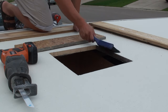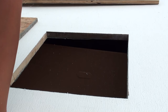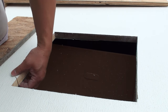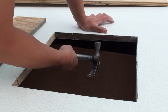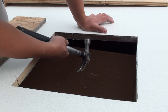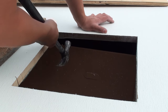Now remember, this is fiberglass, so you can actually get fiberglass slivers, so err on the cautious side. This is what the hole looks like once we've completed the cut as cleanly as we can. I made a minor error by cutting just a bit too far, but that's probably not going to affect structural integrity — it's just a tiny wedge. The weight is being supported by the steel bracing built in from the factory, and you need not worry about the cut being 100% perfect. What we're going to do is take a hammer and hammer up the metal edge against the bottom side of the frame, which keeps those sharp edges pressed down and gives it a nice clean finished look.